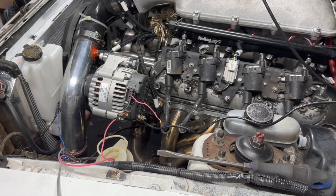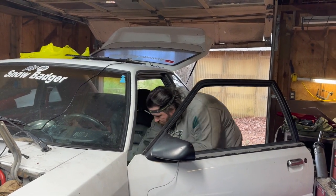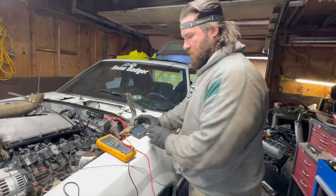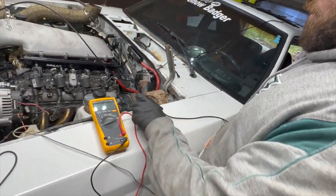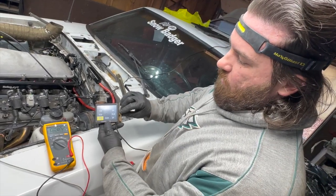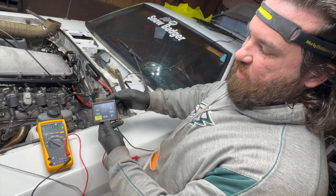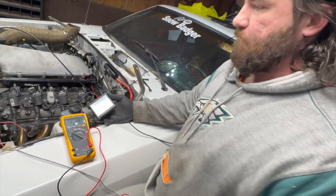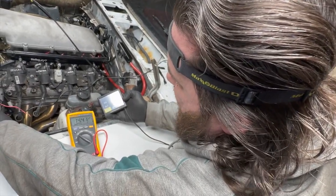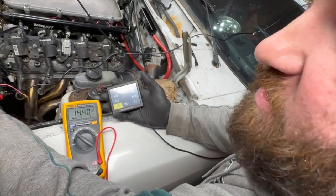It's time to run these wires the way they need to be. On the terminator system we're going to verify that 13.2 voltage and confirm the alternator is actually pushing that out, so we're gonna compare off of these two right here. Right now it's pushing 14.4 and 13.3 and it's holding. We're getting voltage off of that and the alternator is charging the system.